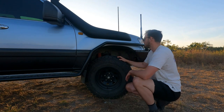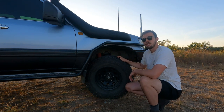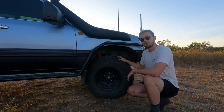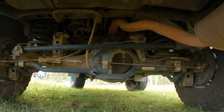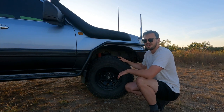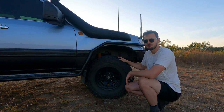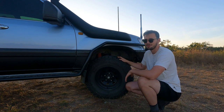For our suspension setup — which, if you ask me, is one of the most important things for a good touring vehicle — we've got 2-inch EFS springs front and rear. For the fronts we've got plus 100 kilos and for the rear plus 500 kilos. We've also got an EFS steering dampener, 30mm sway bars front and rear, and panhard rods front and rear, just to make the car a lot more sturdy on the road. The second we got all that stuff put on, it made an absolutely huge difference. I'd highly recommend getting yourself a good suspension setup if you're doing any sorts of touring.